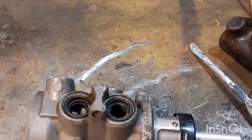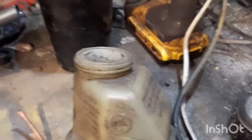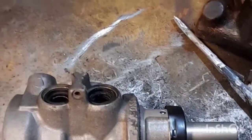All we've got to do is swap that bottle onto there and grind a little tab off. Simple. Master cylinder — little filler cap taken off. As you'll see at the top there's a little tab. Buff that down, put something in the hole so you don't get debris in there. After that, pop that ball out, take them seals out, put them seals in there, stick the bottle on top — happy days.